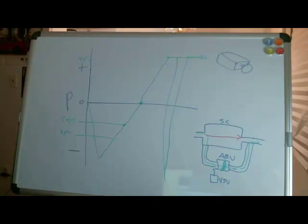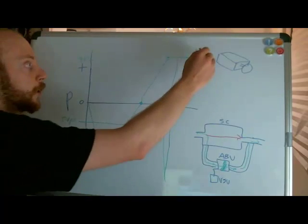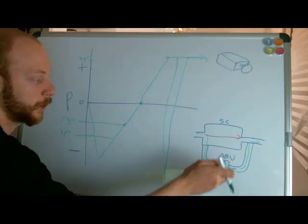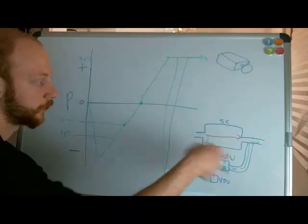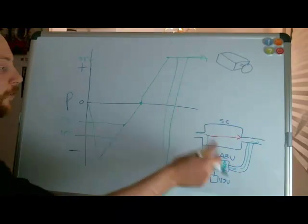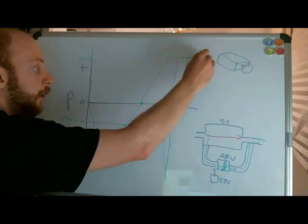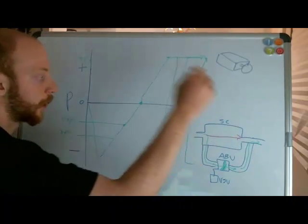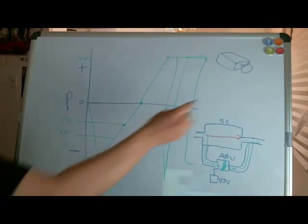Really great system. And if I were to turn my engine off or coast for more than five seconds, the VSV would stop telling the bypass valve to stay closed and just let the system sort itself out mechanically instead of electronically. My pressure would drop, I'd start bypassing my supercharger, and my clutch would disengage.